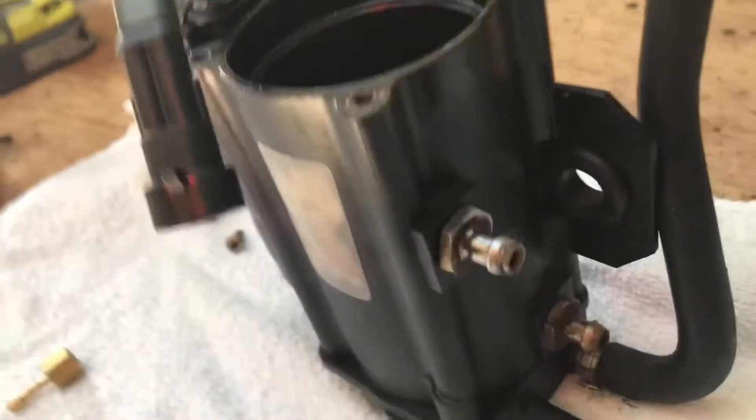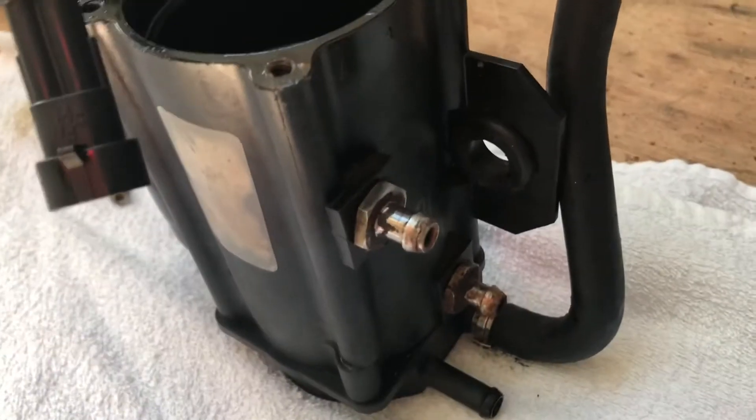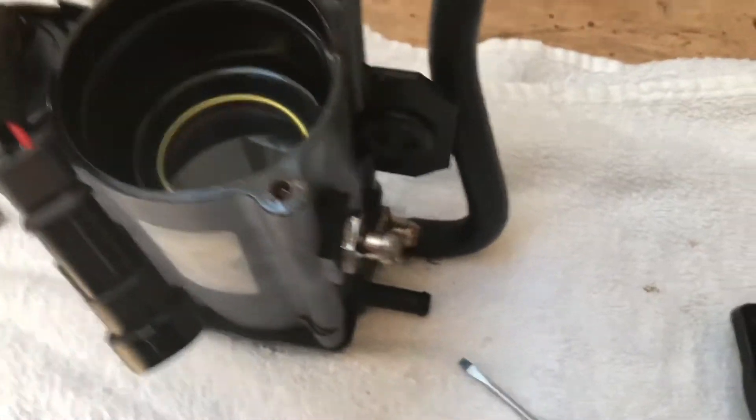A little thing to check if you are doing these things: make sure that your fuel is cooling down, because it will burn pumps. Make sure these water inlets here have been cleaned — no obstruction. You can blow through them. Doesn't taste really good, but yeah, you can do it.